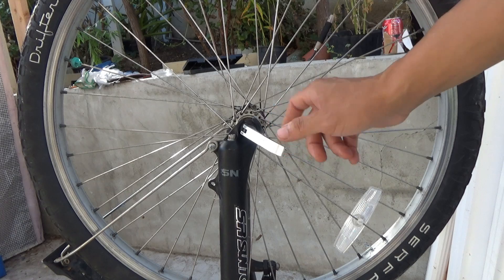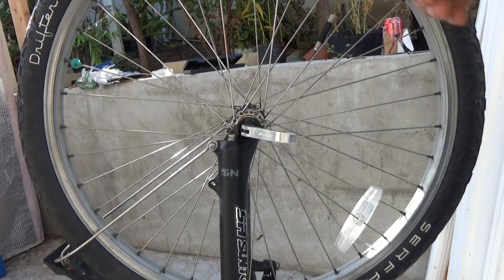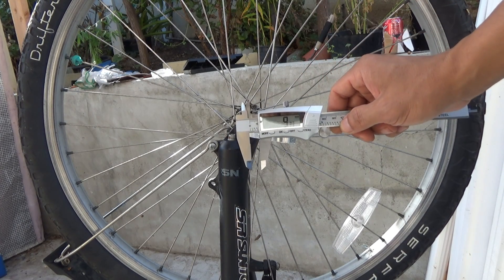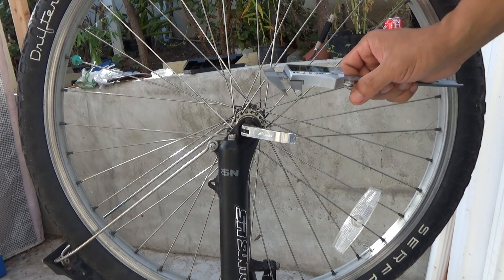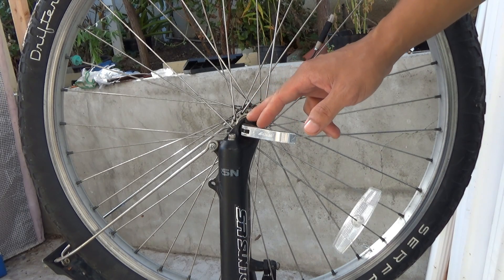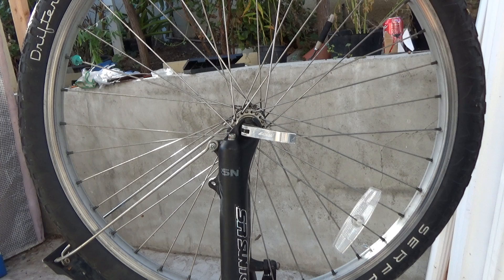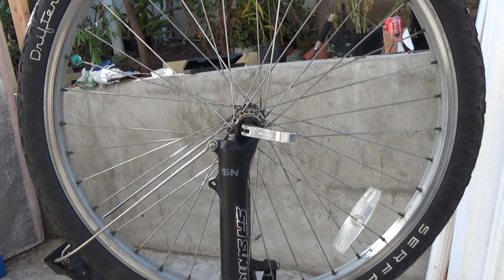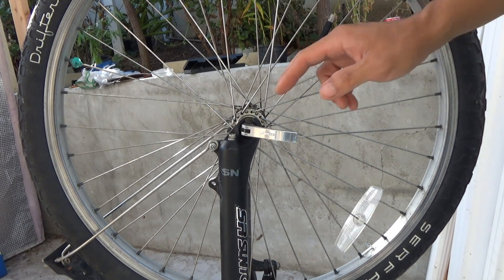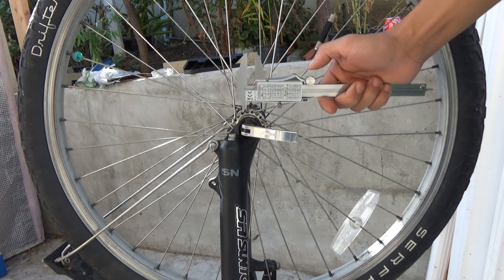This is another bike of mine. It also has a quick release like the other bike, and I originally planned to install the electric motor onto this bike. But the dropout on this bike is only 9.3 millimeters, and I need at least 10. So that means this one is going to need some serious filing — it has to be very accurate because the axle of the electric motor has to be a perfect fit inside the dropout. That's why I changed my plan and installed the electric motor on the other bike instead. So if you want to install the hub motor on your front fork, make sure your dropout is at least 10 millimeters, otherwise you're going to be in for a big surprise.